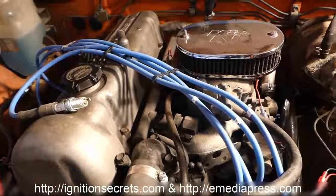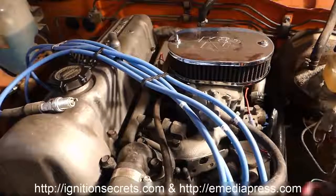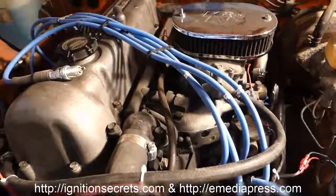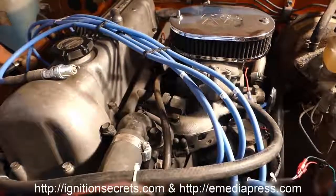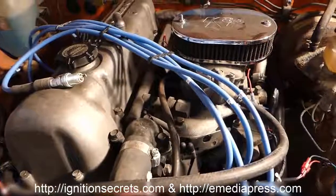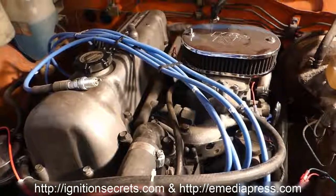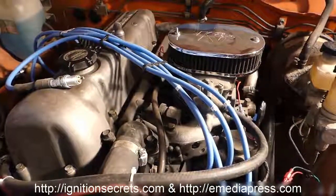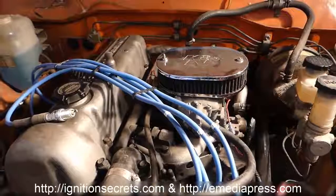And that disruptive discharge right there will thoroughly dissociate hydrogen from any molecule that it's touching or in contact with, like a hydrocarbon molecule from the fuel, or H2O from water vapor in the air, or water injection, or any of the atomic or molecular species coming out of an HHO cell. Plasma will ignite that hydrogen. The hydrogen will have a fast flame propagation speed, will penetrate the rest of the combustion chamber, and will more effectively ignite a lean fuel-air mixture beyond the normal lean burn limits. So test it out.